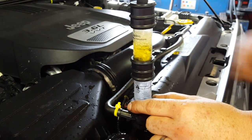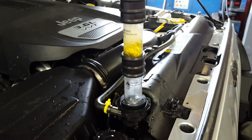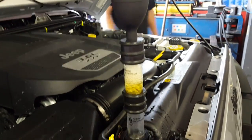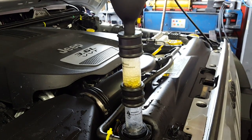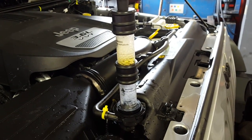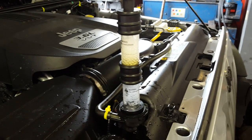You get the exhaust gases in. Is that exhaust gas pumping out right now? That much? Yep. That's your exhaust gases into the cooling system. Yikes. So it's not trickling in — it's a pretty positive flow there. That's probably one of the worst ones I've seen.